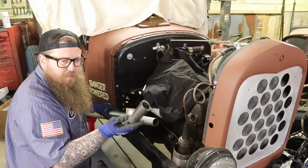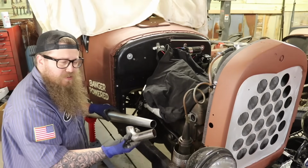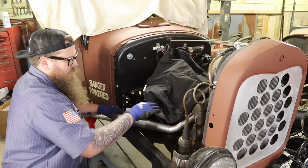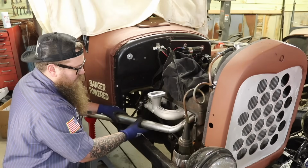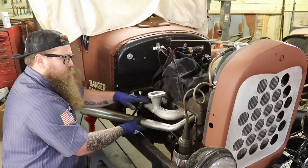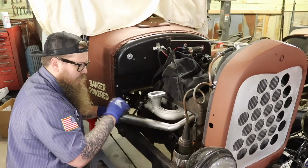Now it's going to be loud because my welder's on right next to the camera, but this kit only left me with one U-bend, so I don't know what I'm really supposed to do with just one. So I'm going to have one here. Then I'm going to take the other half of that U-bend, cut it in half, give me two 45s, so I can come out straight and come up back over from the intake, because the intake comes straight out. The intake doesn't set up above the header. So we need to get below the intake.